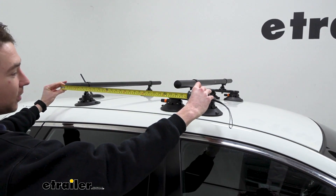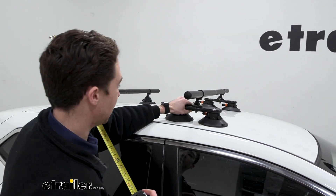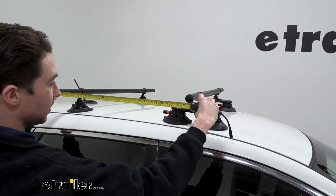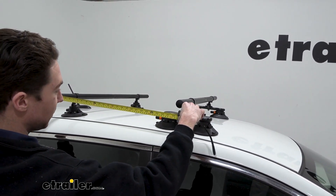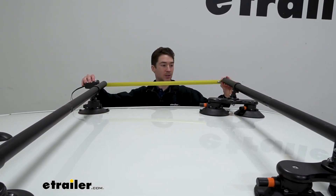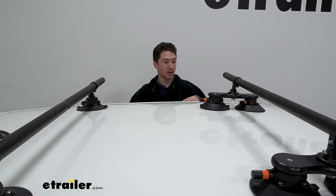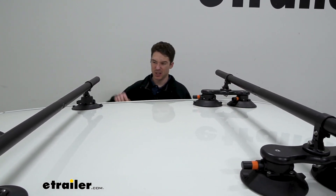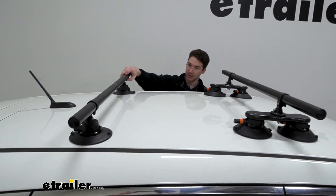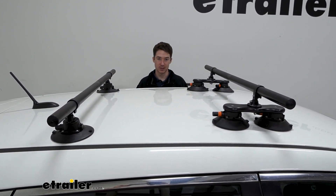Find what works for you, but we find that around 28 inches is a pretty good universal number, so if we have the room for that, that's where we're going to try to wind up. Then I'll have to go and adjust the other side as well as soon as we get that where we need it to be. Here we are on the other side, just making sure that our crossbar spread matches evenly, and if we need to, we can adjust the crossbars back and forth using a four millimeter Allen wrench. In our case, we actually got pretty lucky, so we'll just get them suctioned down.